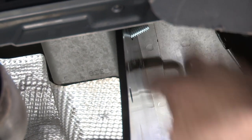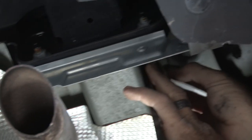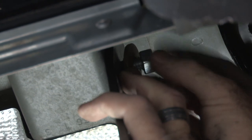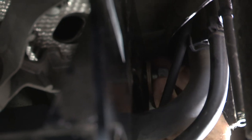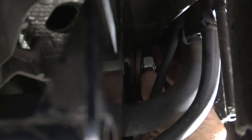Now we have our bolts through the frame and into our hitch holes. We can go ahead and take our fish wire and bolt leads off and put our conical tooth washer and nut on. This is our conical tooth washer — you want the teeth of it contacting the hitch, so put that on first. Be careful not to push the hardware into the frame. Just put some pressure on that washer so as you're putting the nut up there it doesn't fall through. We'll do the same thing on the remaining three bolts. The one right above the filler tube is pretty difficult to get the nut on, but if you just take your time and be patient you'll be able to get your fingers in there and get it twisted on.